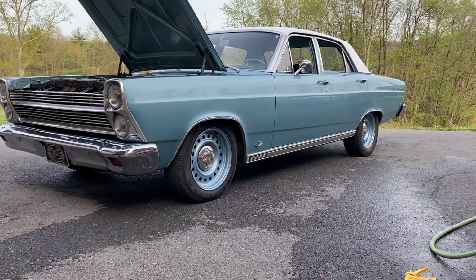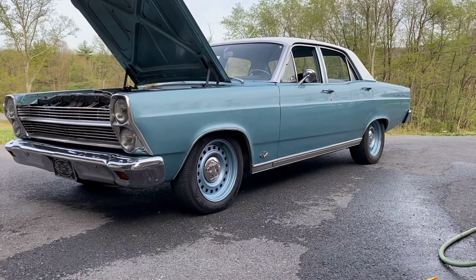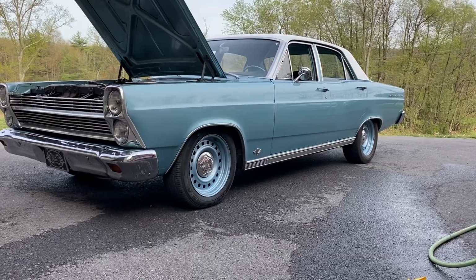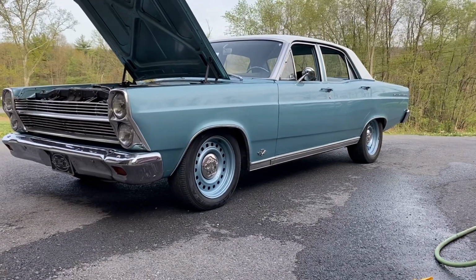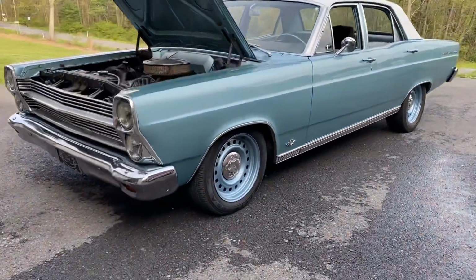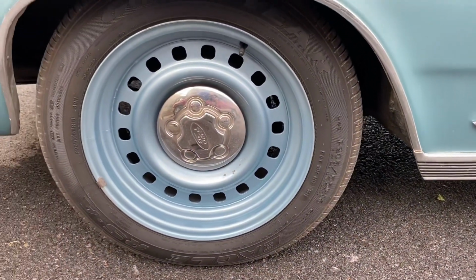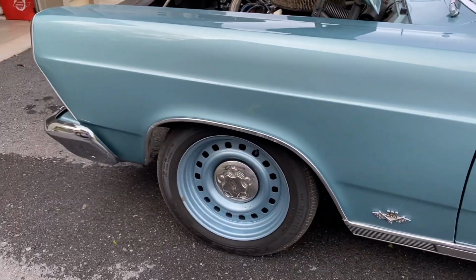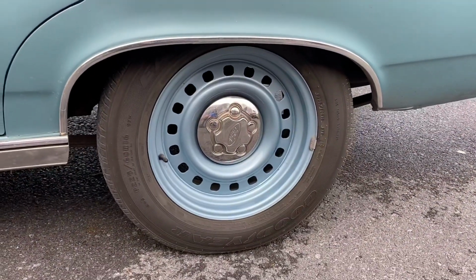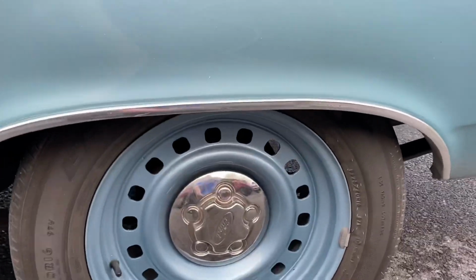And I did the Shelby drop on the front, and those are pre-modular, so pre-2003 Crown Victoria Police Interceptor rims. I believe they came off like a 99 or a 2000. But those are 16-inch rims. And I believe I'm running 205 55 16 fronts, and the Goodyear Eagle RSAs, which match. These are the factory rim off of the police car, the 225 60 16s. But what's nice is these things fit.